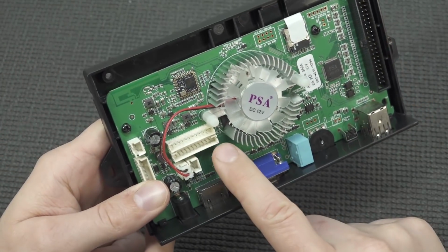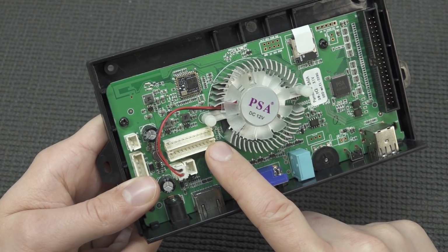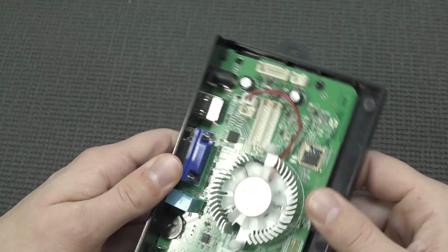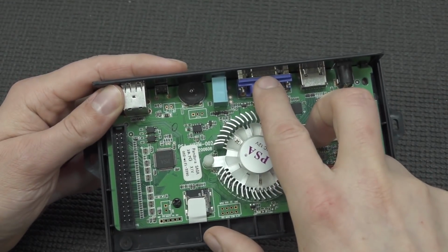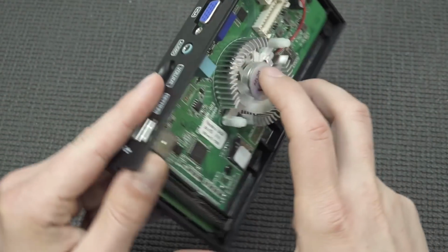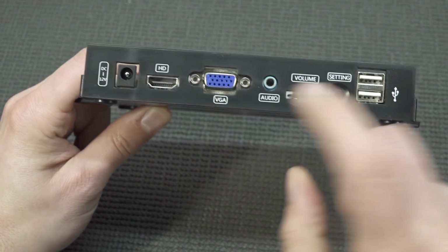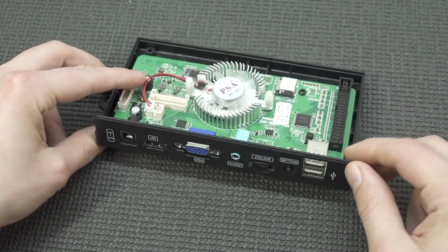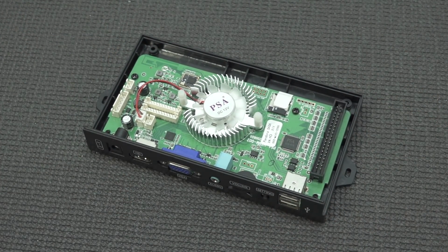One of the things is the connections over here. These connections are not always available on every single mainboard, so that's one thing you need to consider. Another thing is that sometimes they modify this VGA connector and connect it straight into the VGA port. When you look at the back and this thing is blank, it's nearly impossible to find a better replacement board. Sometimes you can find them, but you need to dig very deep into the Pandora jungle.